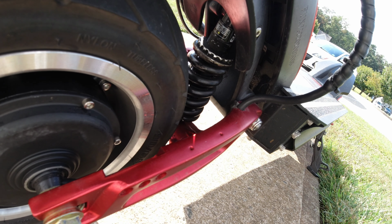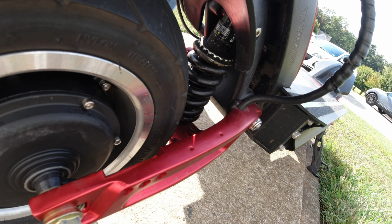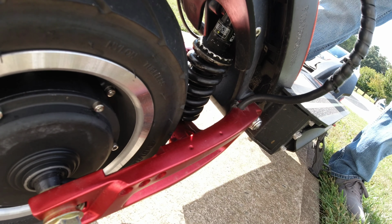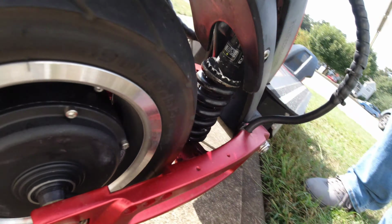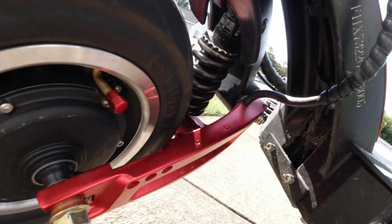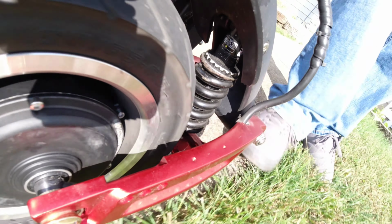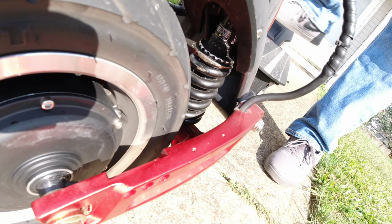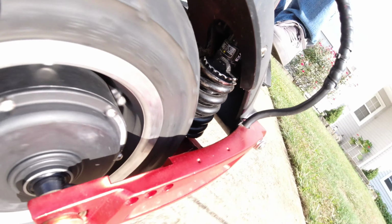You could probably go to AliExpress and type the keywords Taiwan shock springs 165 millimeter, but you actually want the 150 millimeter, because I tried that. I tried to get 2,000 pound rated springs that would fit on this, but they were too long when I ordered 165. So I think 150 would have worked. They took a couple weeks to ship. They were maybe $20 a spring, so $40. So if you know the exact strength of these springs and want to customize it, go ahead.